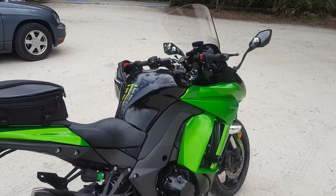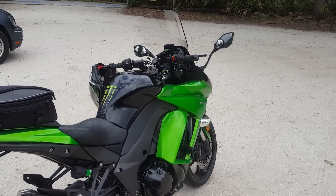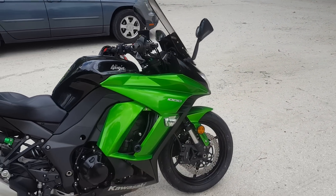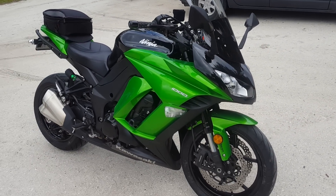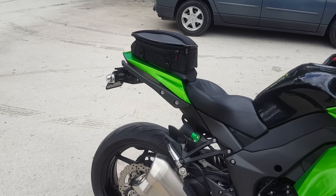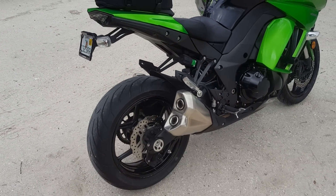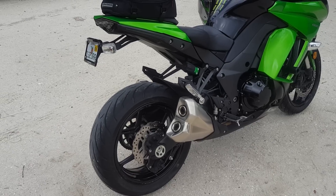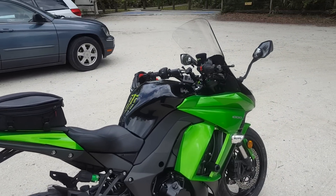In no particular order, one of the things I hated about this bike was the handlebars. The steering was really heavy — you had to put a lot of input on the bars to get the bike to turn, and when it did turn it almost wanted to fall right into the turn. On the forums I read what they suggested and I put a taller tire in the back. I'll put the actual tire I purchased in the comments. It raised the back end a little bit and completely removed that heavy steering — now it's very neutral steering.